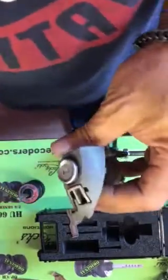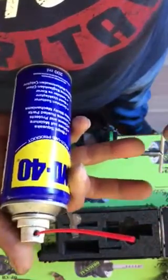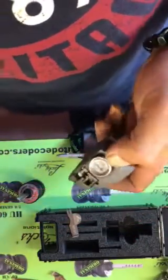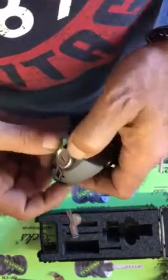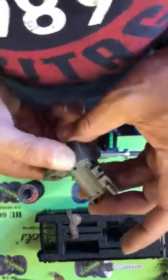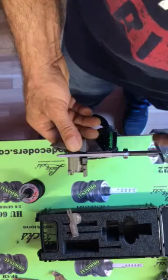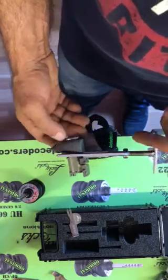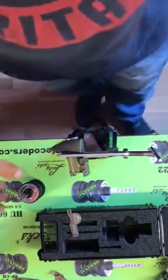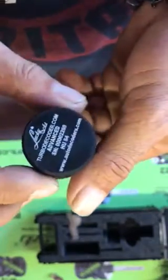The first thing when we approach one Mercedes is to clean the lock with something like this, just to remove the powder and the grease inside of the lock, because as you know they usually use remote control to open the car, and very often inside we found a lot of dirt. The second step is to reset your pins. In that case they are set up, and I will show the reset procedure after the opening.